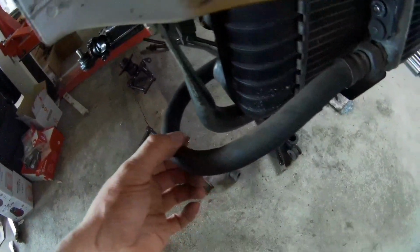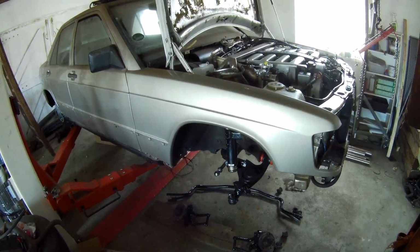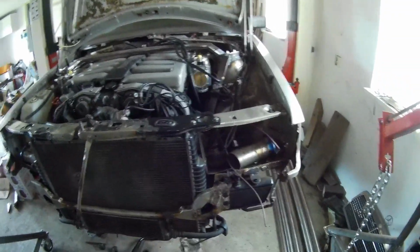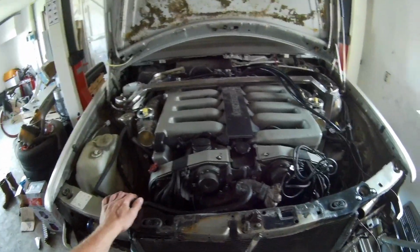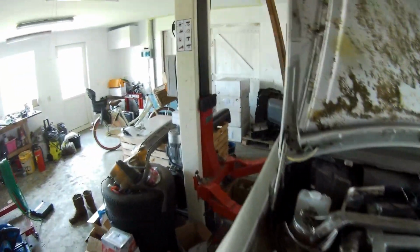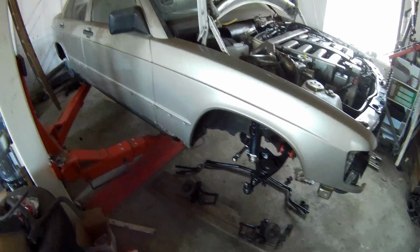The next things that I'm going to do: I have to have a look if I can reuse these oil lines or get new ones made, because these are pretty old, I think. I have to sort out the cooling lines for the oil, and I have to mount the transmission cooling lines, from the transmission underneath the car to the cooler on the right side. So that also needs to be done. If that is all done, then the only thing that needs to be made is the exhaust, but I'm first going to get the engine on the wheels, because I want to have a look how bad the rust spots are in here, and I know there is a hole on both sides, so I have to do that.